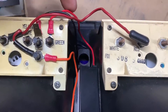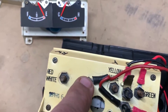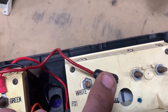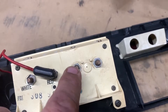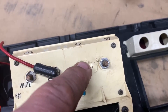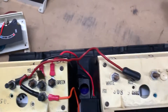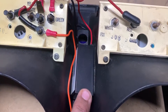Power goes into your regulator, comes out of your regulator, feeds your fuel gauge over there, then goes across and feeds power to your temperature gauge, then across here to your oil pressure gauge. This comes from your oil pressure sender. These connections are your earth for your voltmeter and your power input from your alternator, which gives you your reading for your voltage. So that's a very basic explanation of how your GT GS dash works and how you can save yourself some very expensive repair bills.